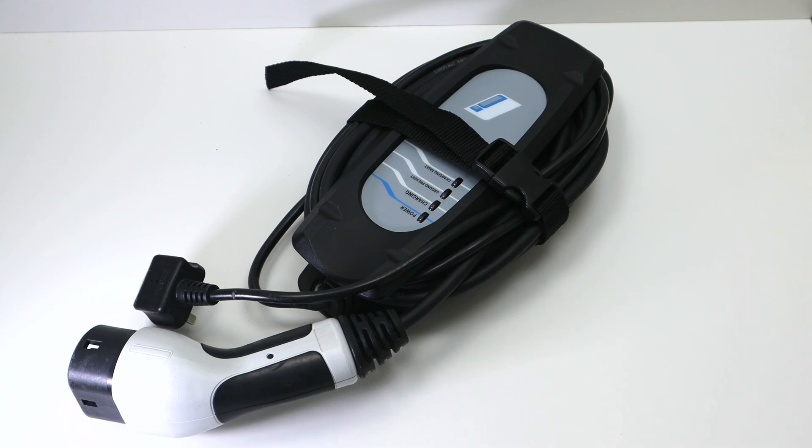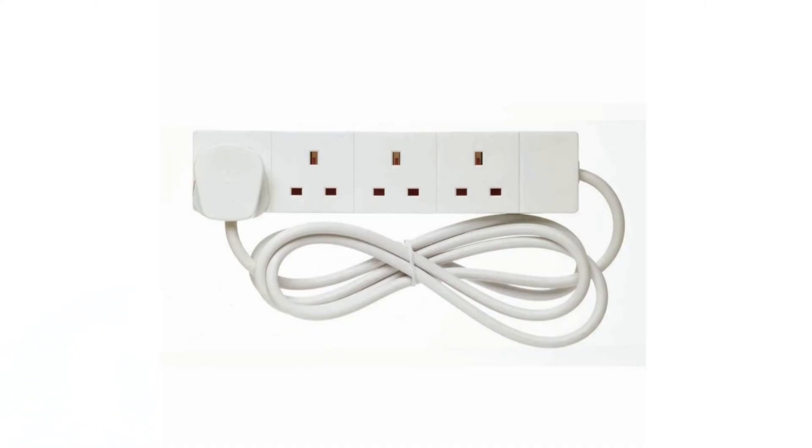If you've got a granny charger, an EV cable like this, and most of them will look something like this, and you want to extend the length of it — normally they're about five metres long when you unravel them — something you can't use is a standard extension cable, like a four-way extension cable you might find in various stores. The reason is mainly that it's just too many amps coming through it; it will just melt. They're not made for use like this, and they're not waterproof either if you're going to be trailing this thing outside. So not really a great idea at all.